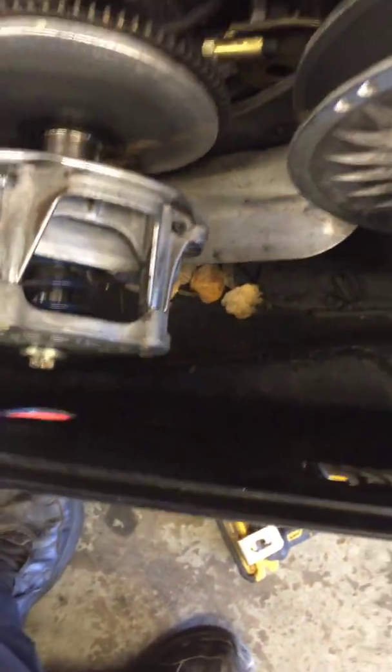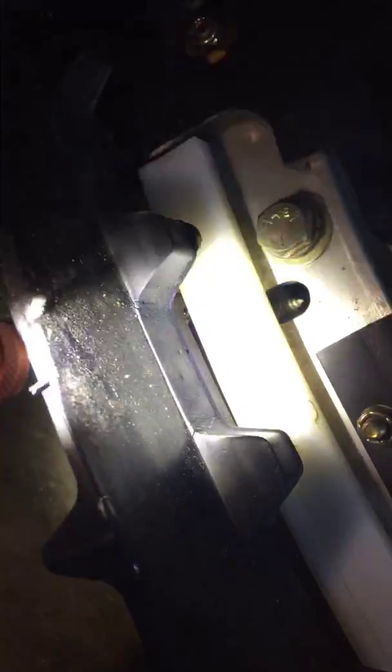Moving back to the back of the slide — your hyfax. So they start out thick up here, you can see that dividing line, and then right about here they're down to about zero. So I definitely recommend doing new hyfax.